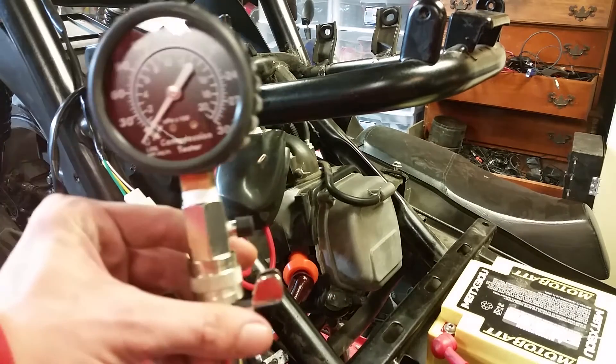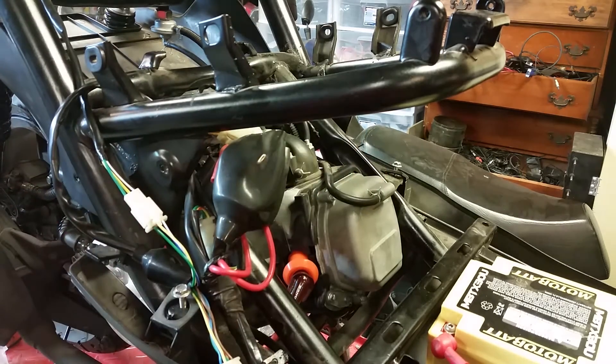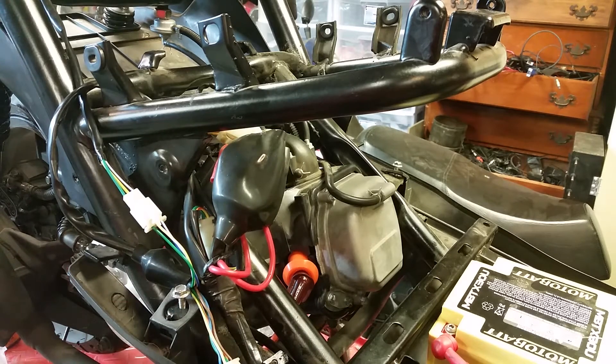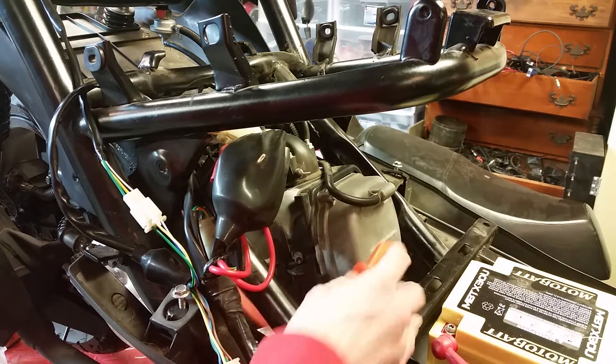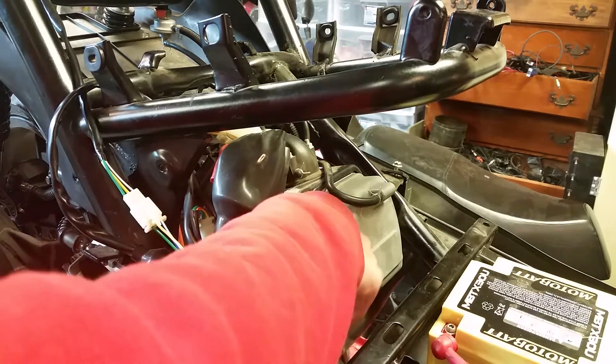This Bosch does come with a rubber hose like the other one, and it's probably what you'll have to use if the plastic is still on the scooter. However, in this case I have the plastic off and everything's easily accessible. To check your compression, the first step is to remove your coil — set it off to the side — and then pull out your spark plug.